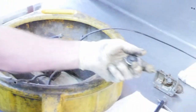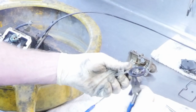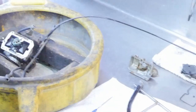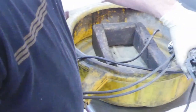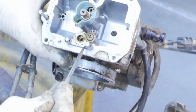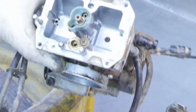This one too comes off. We'll be checking this diaphragm later — looks like it's not messed up at all. Make sure you have a disassembler to take the float out. On this carb, the needle and seat comes out. Most of them don't — the older ones, you'll see they do come out. So we're going to replace it, but I'll show you how to get it out of there easy. They're tricky to get out.